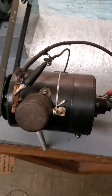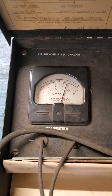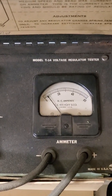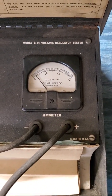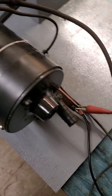I just thought I'd show you how this works. I'm going to turn it on, and it starts charging. Come over here, get my voltage — around 7 volts, as you'll want. I've got the third brush set pretty low right now, so it's only going out about 5 amps, but that's fine. I just want to check it, check out the cutout, make sure it's working properly and that the generator's functioning well. And it is, so it's running along just fine.